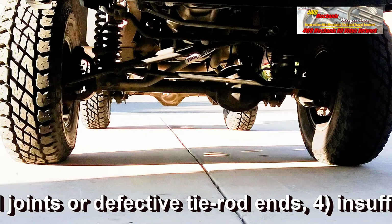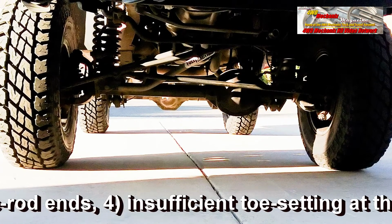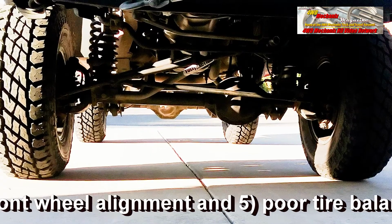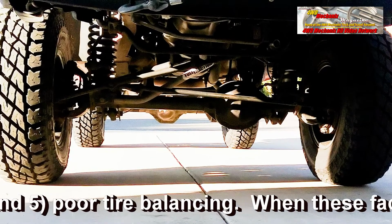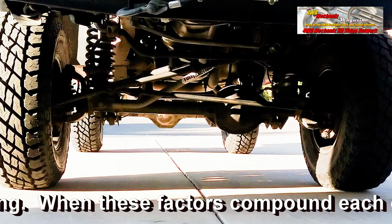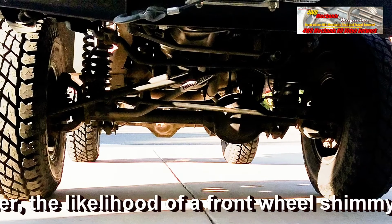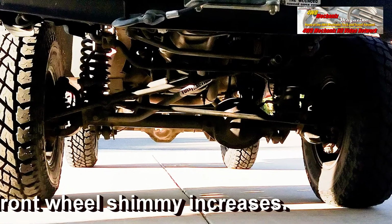On a rigid axle, which 4x4s like a Jeep vehicle would have, or Dodge Ram trucks like ours, you end up with a fluttering effect. This vibration is more predominant at higher speeds. It would be a good guess to assume that that shimmy was taking place on wheels that were centerline or static balanced.